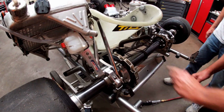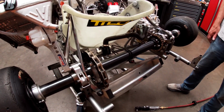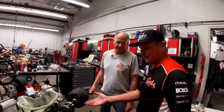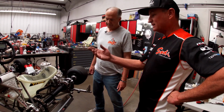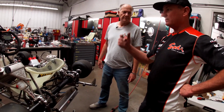Now, here's one thing to remember. With the Honda, it had an internal water pump. So even when we're sitting still and the engine's running, the water pump is working. The water pump's not working on an external water pump unless the wheels are turning. So the Micron will tell you the water temp, but when the water's not circulating, it's not rising in temperature. So if we do just spin the axle or just roll the car forward, then the right number would display on the Micron.